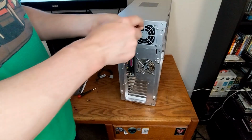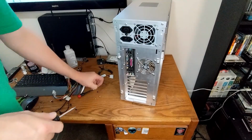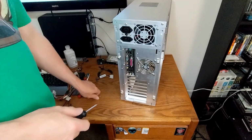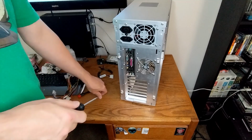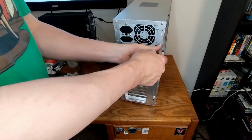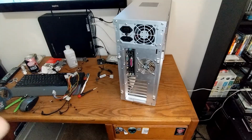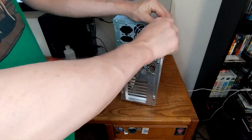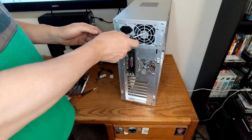So if you remember when I first built this computer, we had a problem with the power supply. Not that the power supply was broken or anything like that, it was simply because there wasn't enough amperage on the 5-volt rail, because these socket 462s need more power on the 5-volt rail than today's power supplies supply. I was using the 1000 watt power supply from my test bench, and it just doesn't supply enough power to the 5-volt rail. The CPU's not happy, and it wouldn't boot half the time. So that's why we're using this older power supply.